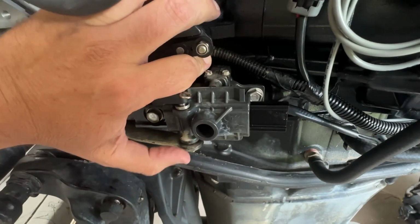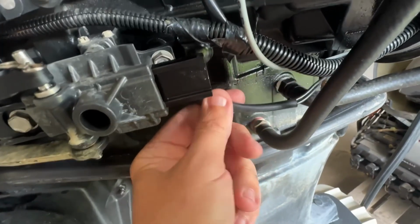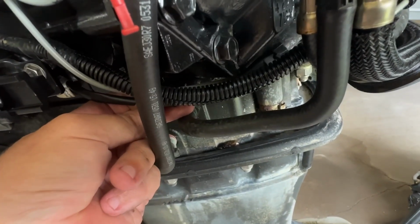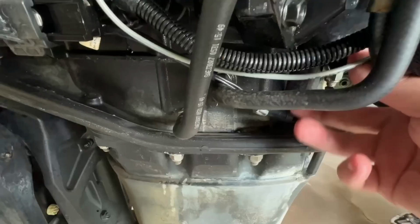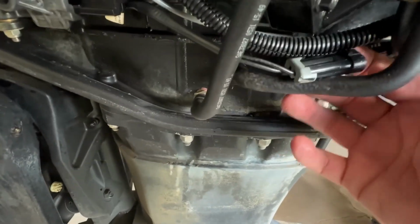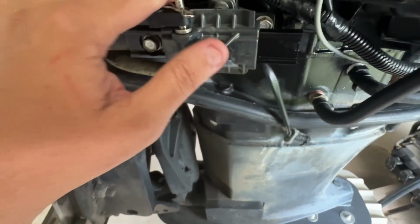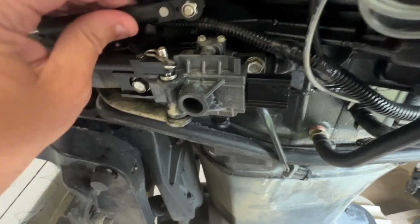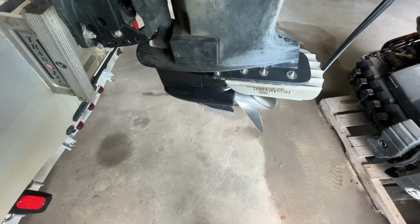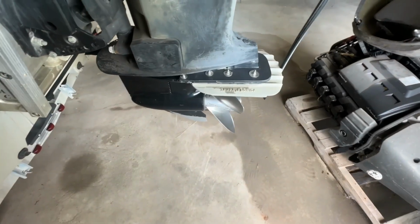So this is a little better look at that shift switch. That wire harness comes down around the back side. This is it, and it's usually connected right up underneath this head. And then obviously this is the plug that I undid out there on the water. We can kind of stick it back down where it goes now. I'm not going to reconnect it because, see, this one's bad and it's fixing to come out. But we'll get this shift switch off and go move the throttle into full throttle. This will get that out of your way. If you are advancing that throttle lever, it might not go very far forward. Make sure you spin your prop to line up that clutch dog in there. Then you'll be able to move the handle.